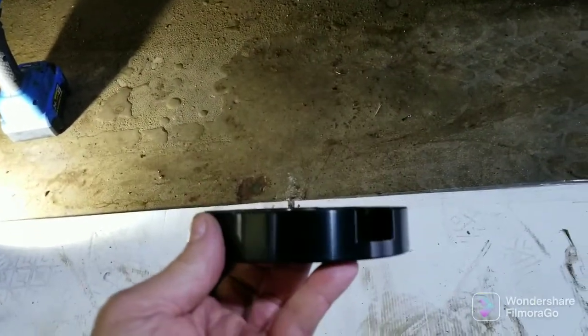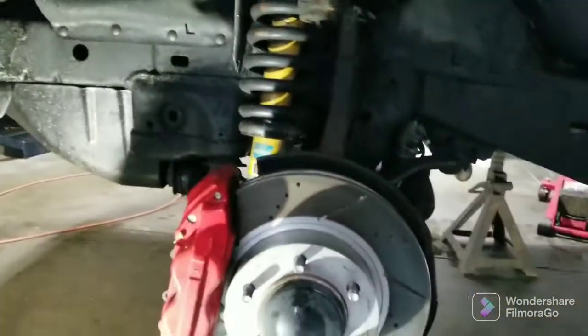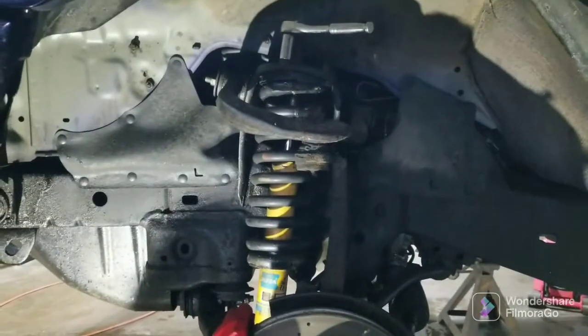I like these though because the bolts go in from the top. Makes it easier to put in. Have both wheels suspended when working with your front suspension. Makes drooping it easier because I'm gonna need to stretch this a little bit, I think.